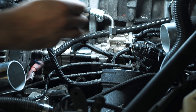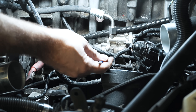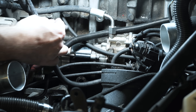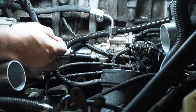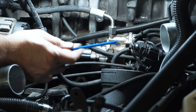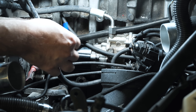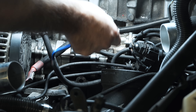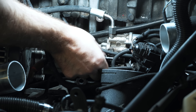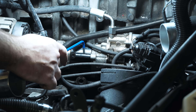This overdrive kit has a few thousand miles on it — getting on four thousand miles — and it's been fine. But there's a known defect where the plate where this bolts up to can crack and leak. I have a leak underneath it, so I believe it's this plate, and eventually you can actually crack your vacuum housing itself. So they make a support bracket now, and I'm retrofitting those parts on.